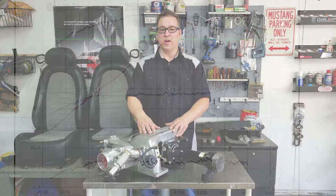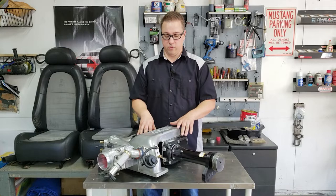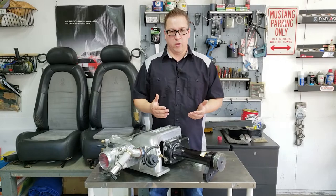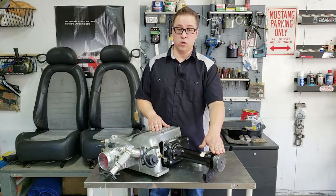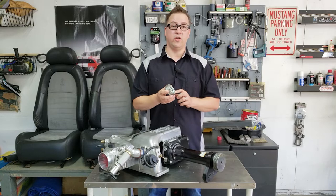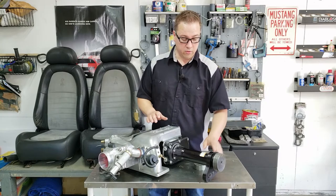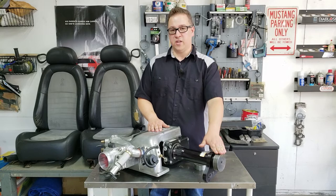It is fairly reliable. I've had absolutely no troubles related to the blower itself, and once it's in there, it tends to stay in there and be pretty robust. The other thing that makes a Kenny Bell excellent is relatively easy boost changes. These pulleys — I'm not sure if they're still available through Kenny Bell — but when they shipped you could basically get one pulley and buy additional pulleys for additional cost. They are made of steel, which is notable because Kenny Bell states your warranty is void if you use an aluminum pulley. I've always maintained factory Kenny Bell pulleys. Right now this is equipped with a 3.5-inch pulley, and in my application a 3.5-inch pulley nets me roughly 10 pounds of boost. On the gauge I see about 8.5 to 9, depending on the weather, because I have a high-flow head.